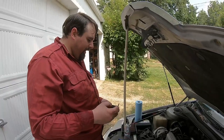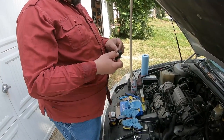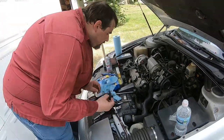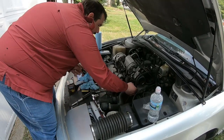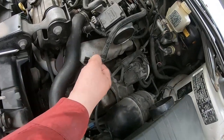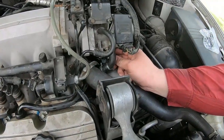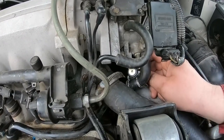I got that cleaned up. It's also a spacer — where this comes forward and meets is where the screw's supposed to line up; it works kind of as a washer. These have lock washers on them as well. Normally I'd use dielectric grease on this, but apparently I'm out. Luckily the gasket on this is still really good — still nice and soft and supple — so it'll seal good.